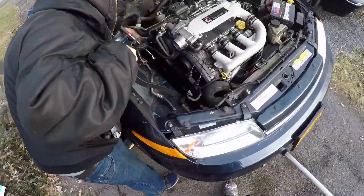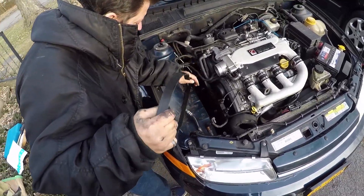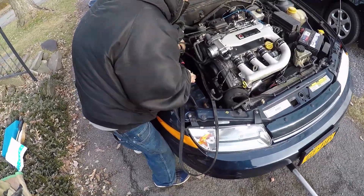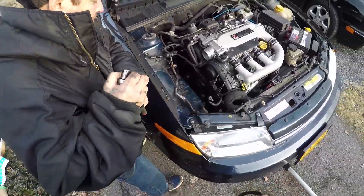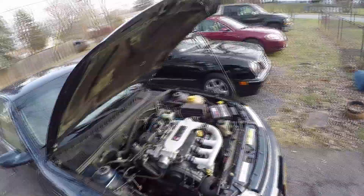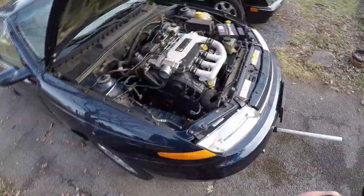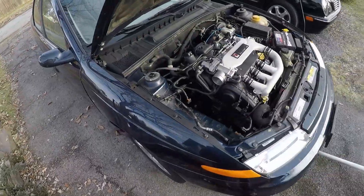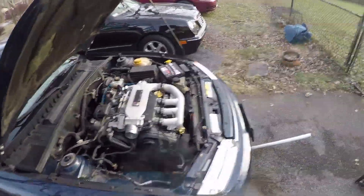You could leave that down or just lower it. I don't think it's going to get tangled. We're just going to kick this engine over and see if that noise is still there, to verify that it's coming from the timing belt pulley and not one of the accessory pulleys. We're pretty certain it's coming from the timing belt pulley or within that area. Don't run your car for a long time without the accessory belt on because the water pump will not be operating, but running it for a minute is not going to hurt it.